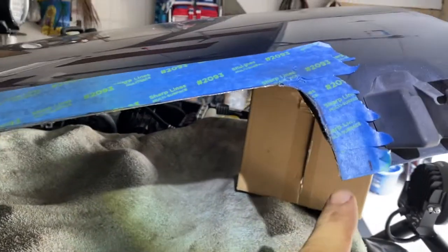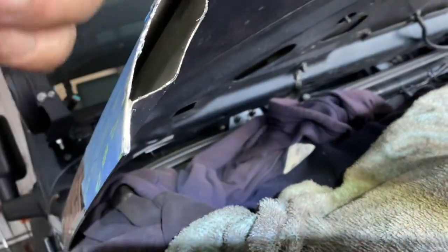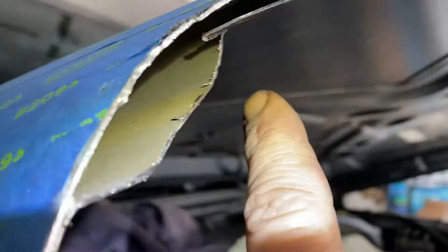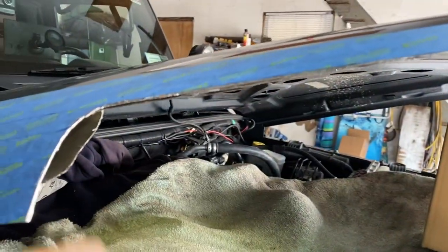I made my cut and it still showed just a little bit of the line. You'll be cutting through two layers — I used the cutoff wheel first, then cut the rest out. For the bottom piece, I made little relief cuts on each side so I could bend it up — it was hanging down, so instead of cutting more I just made a small slice there and there, bent that piece up, and sanded it down. Take all the burrs off with a file and paint the exposed metal.